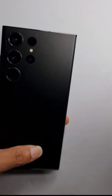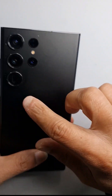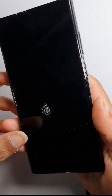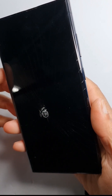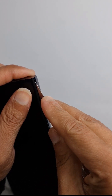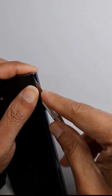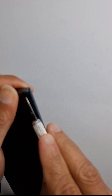I'm going to show you how to repair a Samsung S23 Ultra. The back is fine and as you can see the screen is cracked right over here. The phone has already been heated up and I'm going to open the back glass. I'll start by making a small gap to insert my pry tool — this step is very common for most Samsung phones. Take your time.